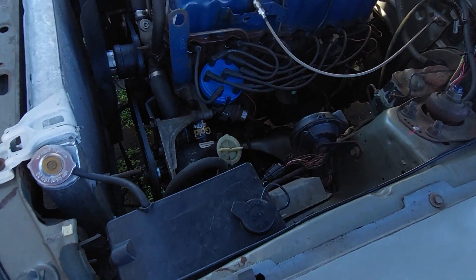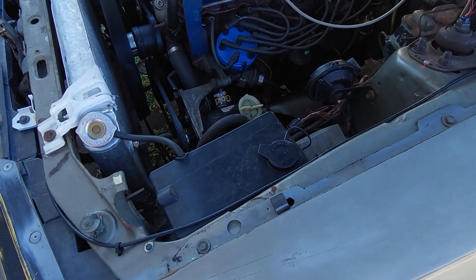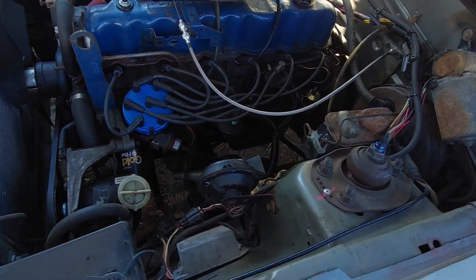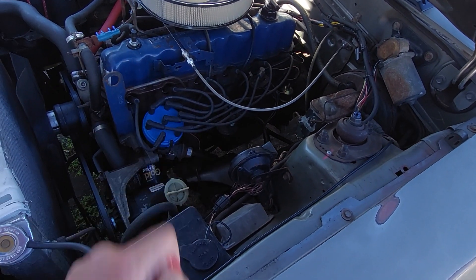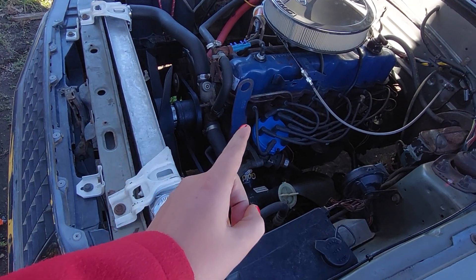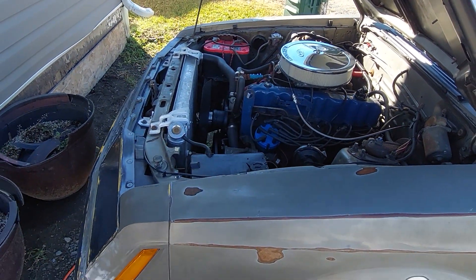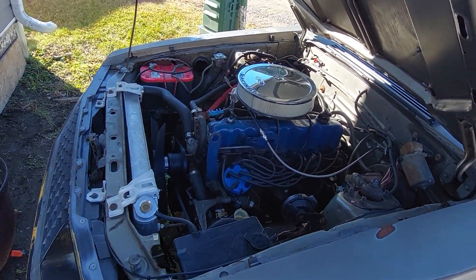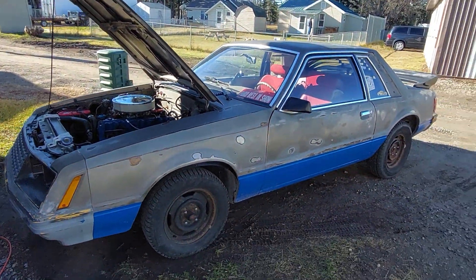I will eventually have to replace the plug wires because they are getting a little hard, and they've only been on the car for about a year and a half. Those will be up next. But I ordered two things I mentioned: a new coil — it's a Super SL, so much better than stock — and a double roller timing chain from Claysmith Cams, because when this thing starts it does have a sort of a shake, and that's what's going to be next on the list.